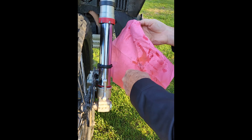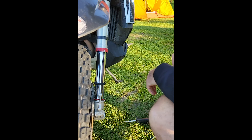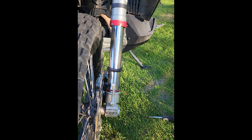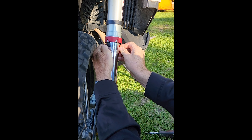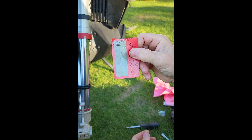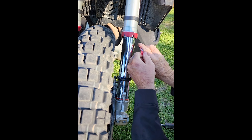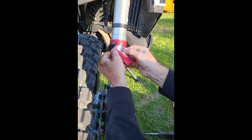We're going to try to clean the dirt and mud out of the fork seal with some improvised tools and see if we can get them to stop leaking, because everything is just doused in oil at this point. We did stop at the car wash to pressure wash the bike and soap them down, which is a good idea because it helps keep dirt from causing any more damage. What Jeff did is he made an improvised seal cleaner with a plastic card, working it up inside the seal with a little hook shape to grab any mud or stuff trapped in there. It only takes a small particle of dirt or mud to cause these things to start leaking. They do make a proper tool for this and that's what we should have, but we don't.